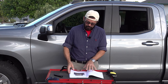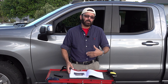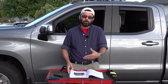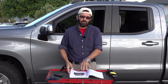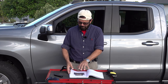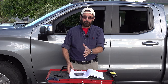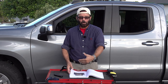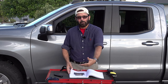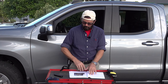When you do the cutting and you measure in a half an inch, well, at least on mine it is a half an inch. I don't know what it'll be on yours if you have a different style truck. Make sure you stay at the exact same angles as are on the template. Don't try to make rounded edges. If they're squared off on the template, keep them the same direction. Just go into the template by a half an inch, quarter inch, whatever you end up cutting it at.